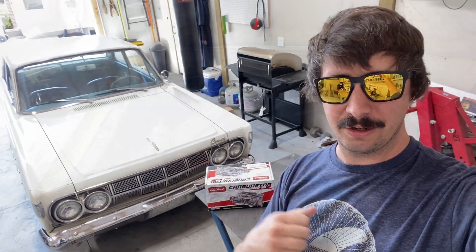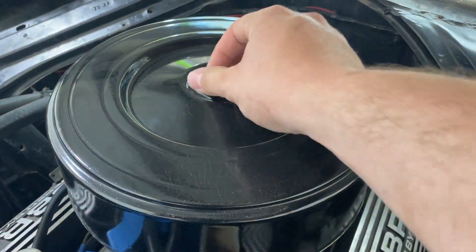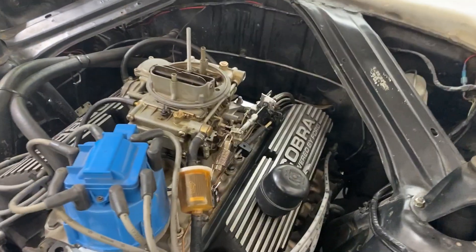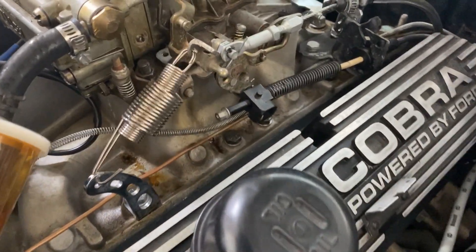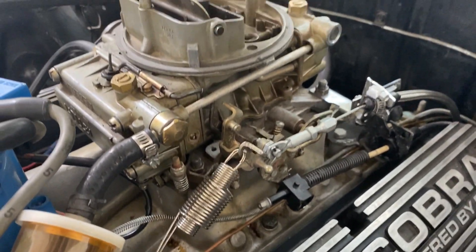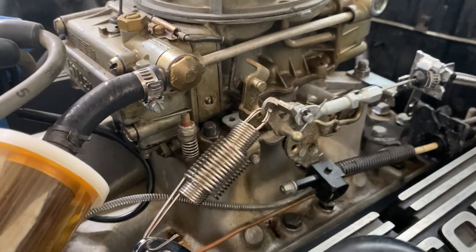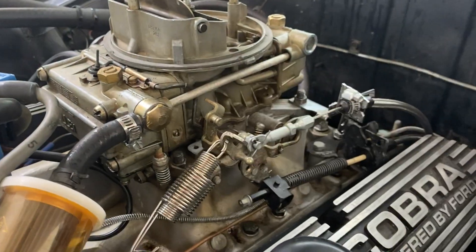This is just going to be a very basic carburetor install, getting it on the road. We're not going to be fine tuning until we get the wideband, but more on that to come. In here we've got the 302 Ford. Let's pop off the air cleaner. There she is — 450 Holley. This has been sitting overnight. I haven't driven it and there is still liquid fuel. It's not just a tiny drip that's evaporated — it's a pretty good size leak, coming from the underside front of this old 450 Holley.